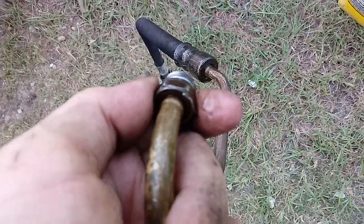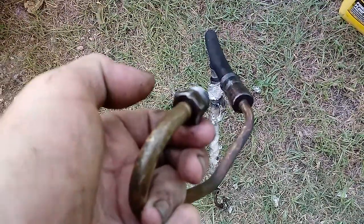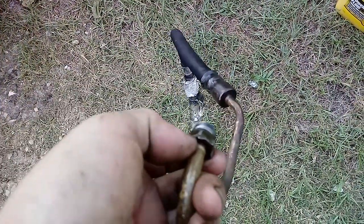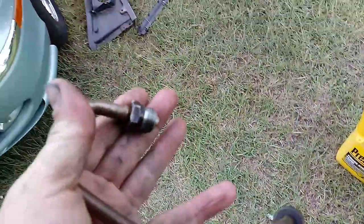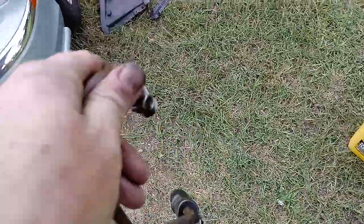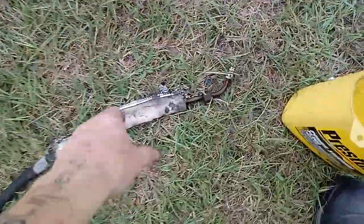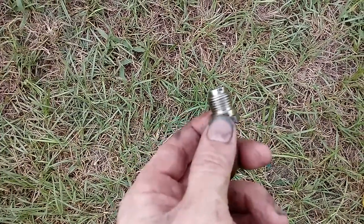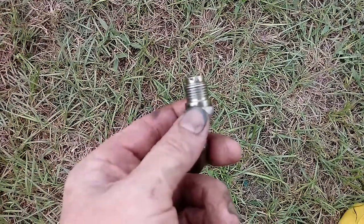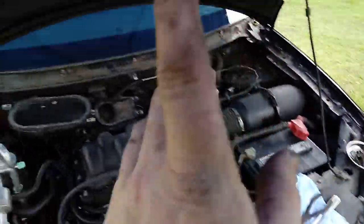What a lot of people don't know is this isn't like your old brake lines where the fitting spins freely inside the nut. There is a seal inside, and yes, it goes bad. When it does, it will just shoot straight out like a squirt gun — doesn't matter how tight you make it. When that happens, it is game over; you have to change the line. There's nothing else you can do — you can't JB Weld it, it will just pour right out. Here's a better example: see how this side is still good, it's just starting to spin. This one wasn't leaking. Watch this other one — there you go.